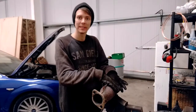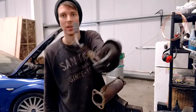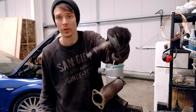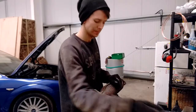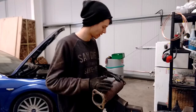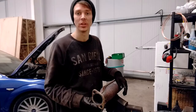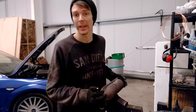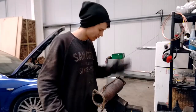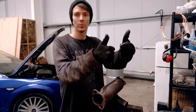Got the cat off, got it in the vise now. Remove the heat shield and remove the O2 sensor — obviously we need that to make the car work, so that's going back in. We're going to cut the flanges off because we don't need the cat body — we're going to weld in a straight pipe to make it a decat. We need the flanges, so cut that one, cut that one — one piece of pipe in the middle, job's good.